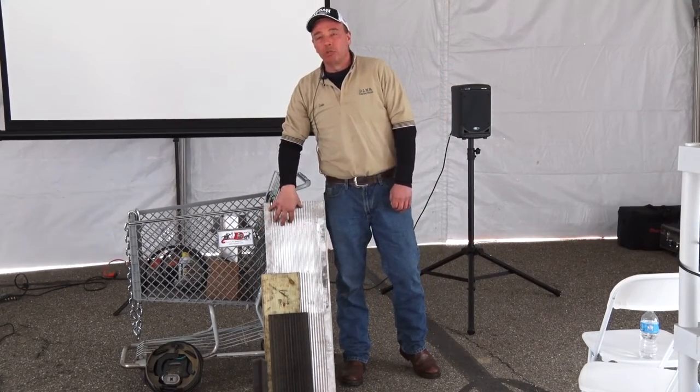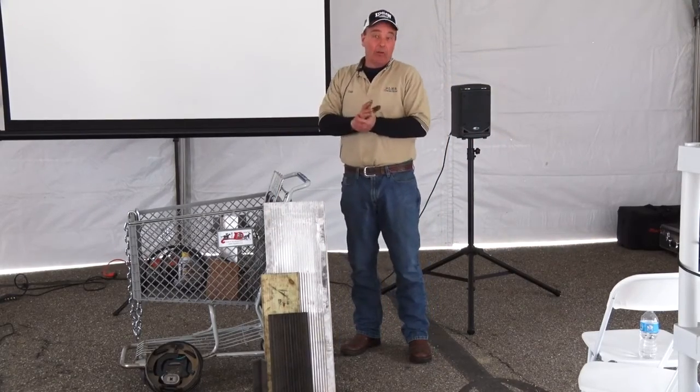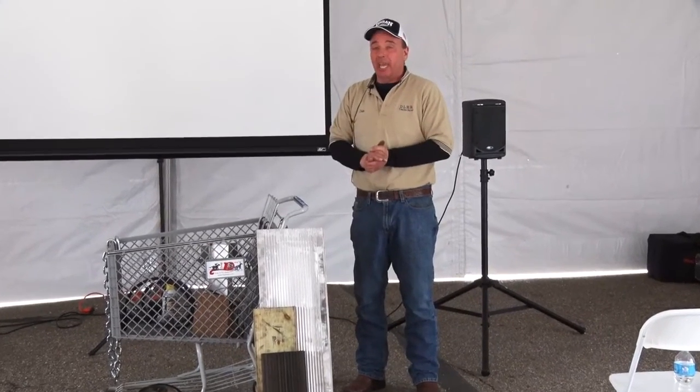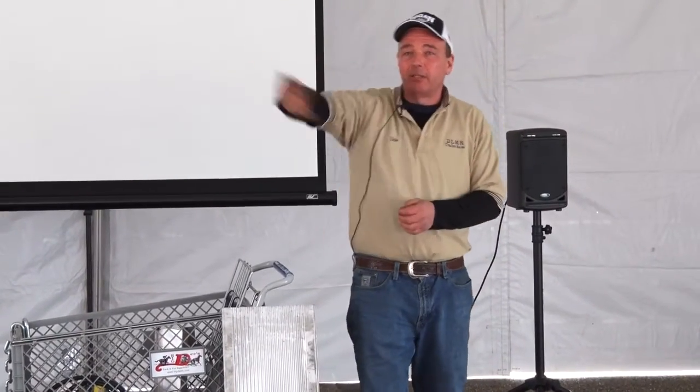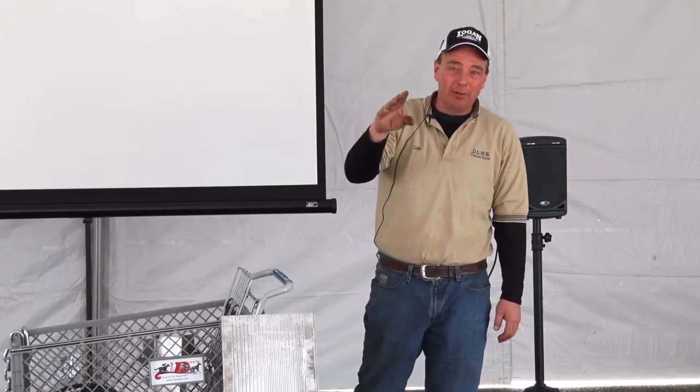You can go to shows, the big quarter horse congress, pretty much any place that there's a lot of horse trailers for sale, and especially if there was a rainstorm or rained the past couple of days, open up that rear horse area, lift up that mat, and I guarantee it will be soaking wet in rainwater. Okay? That's what happens with your horse's urine. It sits underneath, you don't pull the mats, and that urine just eats through that aluminum, and it's riddled with holes. Has anybody ever seen a horse's hoof go through a floor?